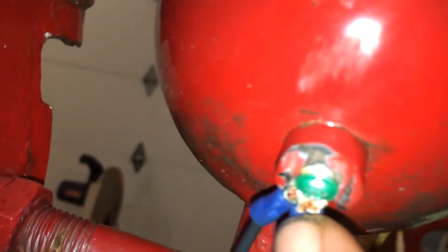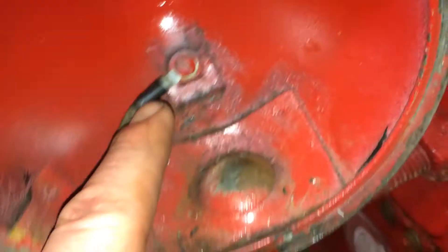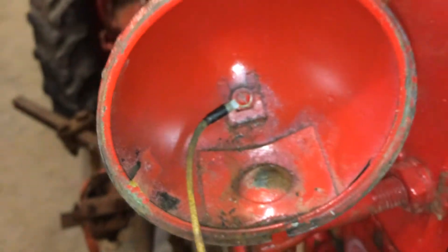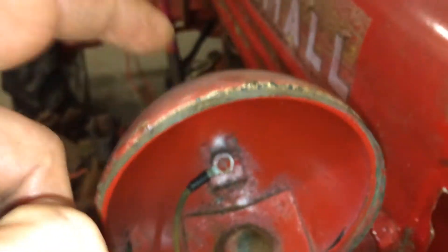This post is an insulation material, so your terminals can touch this post and you don't have to worry about grounding out. The light fixture is actually wired into the back side of that, and it's all held together with a clip. That's how you can get through this metal housing and your lights are not shorted.